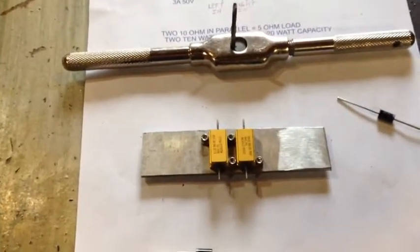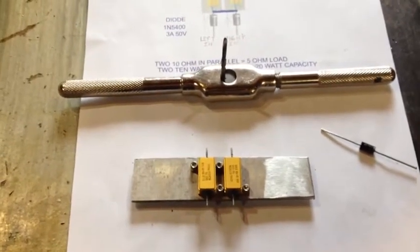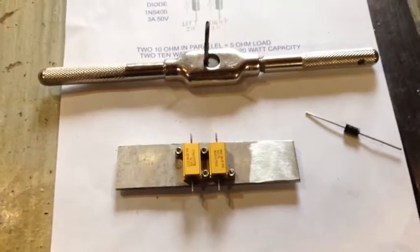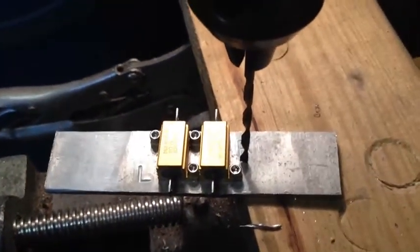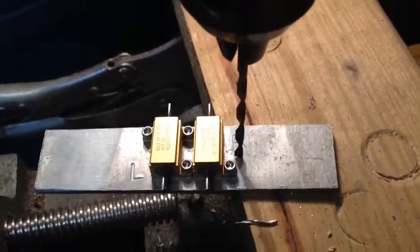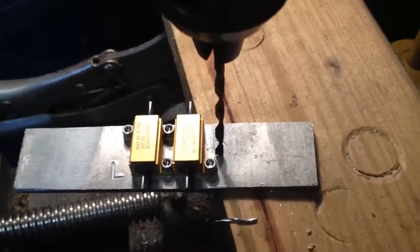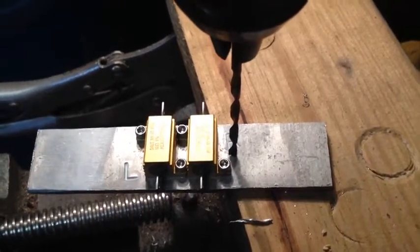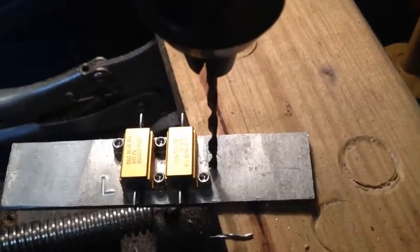This is the piece of aluminum with the resistors attached — the holes are tapped out. The next step is to drill some small holes to pass wires down to the turn signal module. I'm going to drill some 1/8" holes on each side of these resistors; this will allow me to pass the wire coming up from the turn signal module to this block where they can be soldered to the resistors. I chose this way so the wires drop to the back side and don't have any interference from the top.